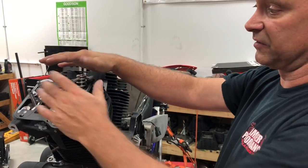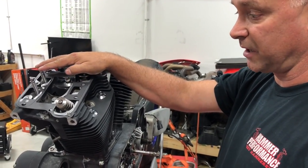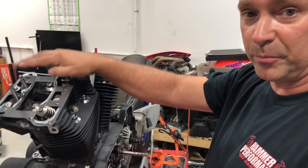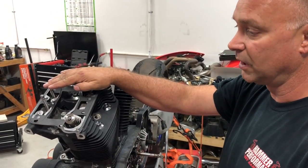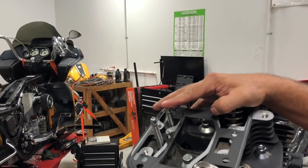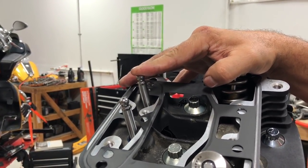If you have the assembly set on there, you can watch that rocker arm, but we're going to watch the intake push rod. And what we want is the piston all the way to the top after our intake push rod goes up and goes down, or opens and closes. Okay, that's one way, and I'll show you that way here. So as we see the exhaust open and close there, here comes our intake open and our intake closes.